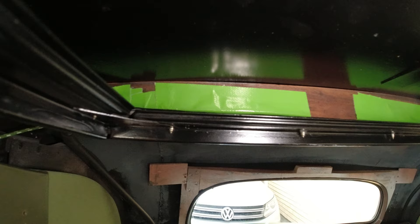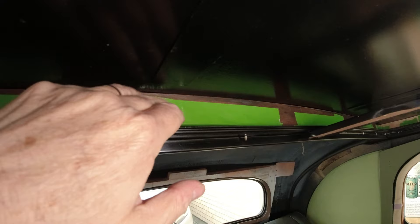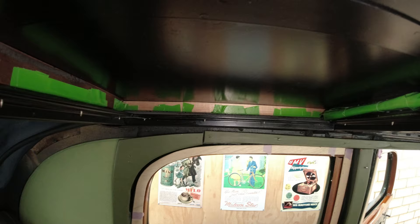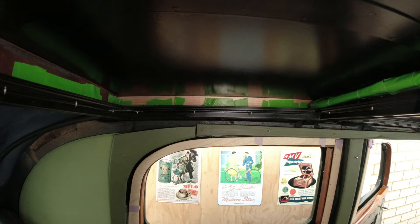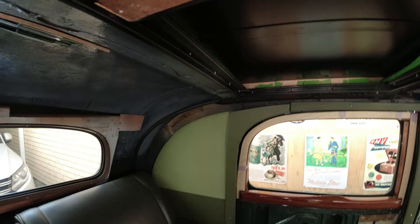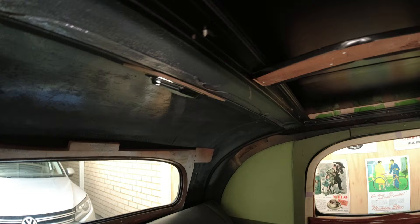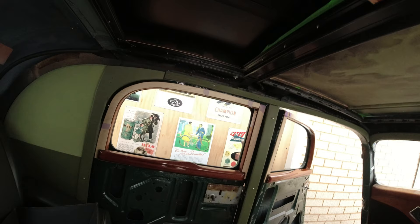I'm here in the car now to show a few bits of this sunroof assembly. That's the back edge of the fixed section — you can see this heavy duty piece of timber framework. As we track along the side, you can see a new piece of timber that's been made for the framework. The spacers are essentially hidden by the rail that the sliding section of the sunroof runs on. Here you can see that inner fixed section without the fabric cover on it — I've got it all tacked together and ready to be pulled out again for motor trimming.